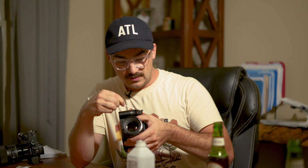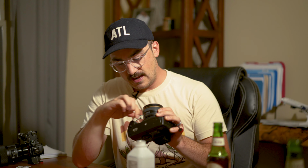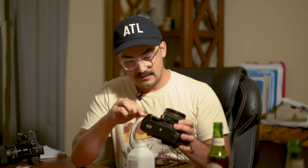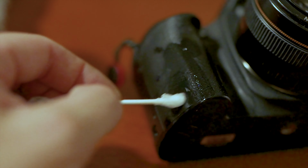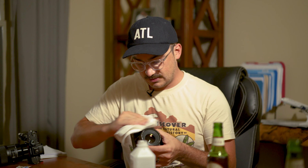You're gonna be trying to avoid the electronics, really just getting on that rubberized surface, and you're gonna go to town on this thing, layer by layer. Your Q-tip's gonna die, flip it over, use the other side, dip it back in the alcohol, and you're just gonna try to get every little bit off. And every once in a while, take your paper towel, wipe it off. For the large areas, I actually found that I could take the paper towel with about 4 layers, so it's a little thicker, do a little dip, and hit the area as well. Again, trying to avoid the electronics.